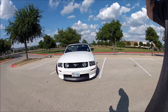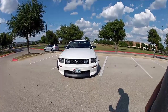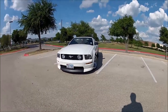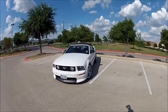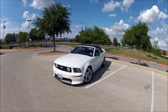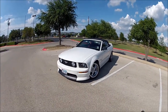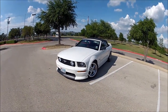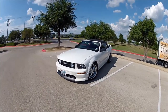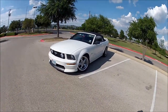I did notice a little bit of a difference. If I was still on stock suspension, the front nose would come up a lot more than it does — but the aftermarket suspension I have is really geared towards handling, so that stops a lot of the weight transfer. At least this helped me get some of it. The car came with about 305 to 310 horsepower. With the cams, intake manifold, throttle body, intake, long tube headers, and electric water pump, I'm looking at somewhere right about 415 to 420 at the crank. Wheel horsepower on a good day is somewhere around 350 to 360. On drag radials, mid-12s no problem.